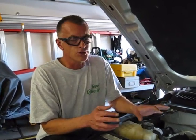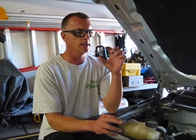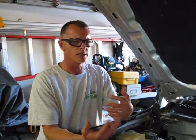Okay, we've gotten all the connectors off of the injectors. On the passenger side, it was a lot easier to do. I personally never successfully got one of those off of there. Evan did them all. He just figured out how they were supposed to go. I tried to watch, it didn't work out for me. Hey, we go with what we've got here, right? Passenger side was easier because the connector is actually asymmetrical, and it works to your benefit on the passenger side. You can see it better. There's a little more room, not as much plumbing and wires and all this other stuff. So he zipped through those things in no time flat.